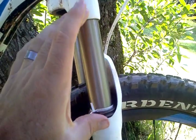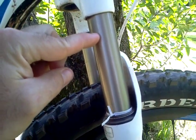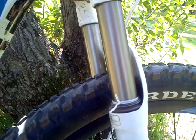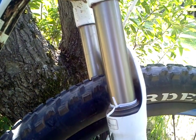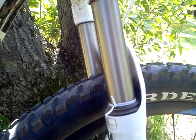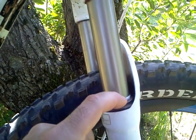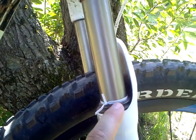This particular bike has 4 inches of travel. Now the top of the travel is right about there, so if you're hitting there, you're bottoming out. But the bigger problem I usually see is that people are running too much air in their forks. Now, they have these little rings called travel indicators — and sometimes they pop off; mine's popped off.